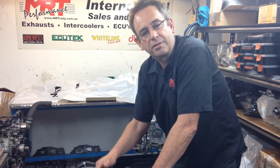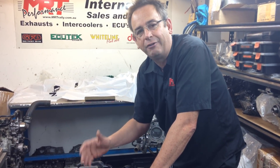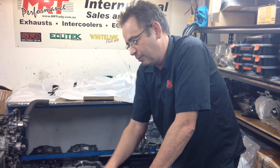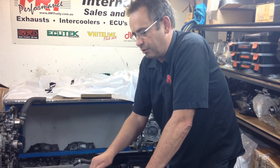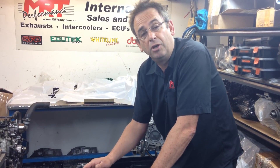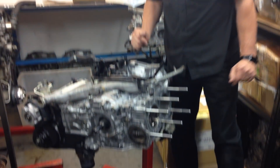It's not about mid-range or top-end power increase with variable cam control — a lot of it is bottom-end torque, getting the engine to come on boost as early as possible. In some situations we've seen cars from other workshops where tuners haven't quite got the cam timing dialled in correctly, and we've managed to get cars coming on boost up to 500 RPM earlier with exactly the same mechanical parts.